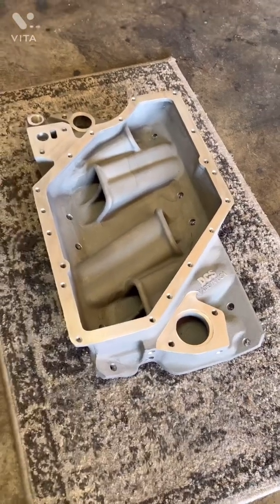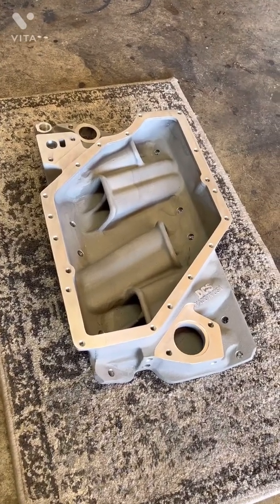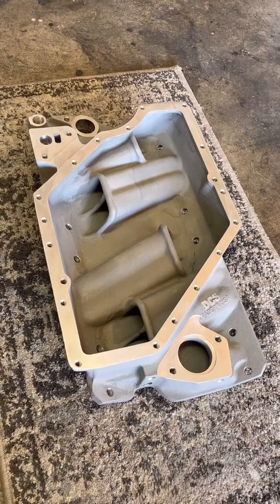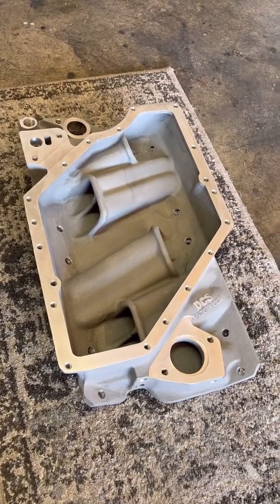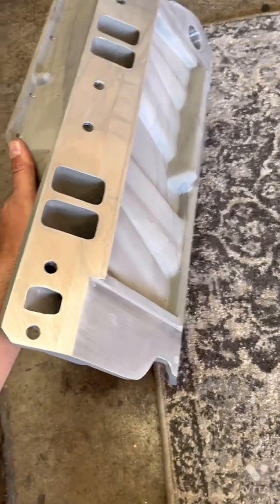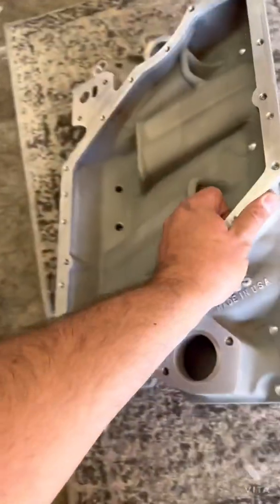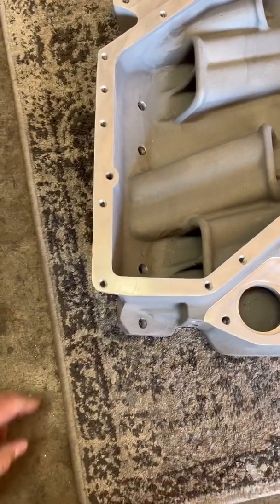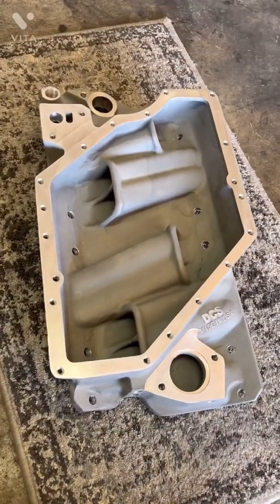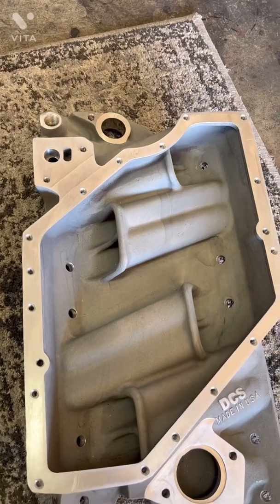Since I've heard a lot of bad things about the fitment of these manifolds toward the last part of the production run, I went ahead and verified the fit on a small block long block. All the intake ports line up, all the intake bolts line up, it actually seems to be machined pretty well. That's just some brake cleaner staining. I don't really see any problems with it whatsoever, other than a couple of these top plate bolts being a little bit close to the edge. I test fitted a thermostat housing with a thermostat and dropped a distributor in when it was sitting on the block — everything lines up perfect.